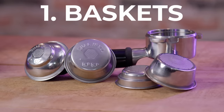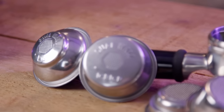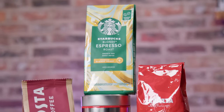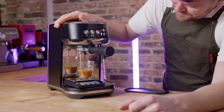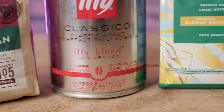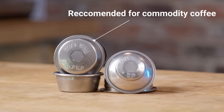So why is this really small, relatively cheap machine capable of making such good espresso? There are five main reasons. First, let's have some basket banter. The Bambino Plus comes with both standard baskets and pressurized dual-walled baskets. Most cheaper entry-level machines are pressurized basket machines made to work with pre-ground coffee — they're more about making espresso look and taste the part, which is why Gaggia refer to them as perfect crema baskets. You can't really dial in with pressurized baskets. If you're using commodity coffee with no roasted-on date, you're better off using a pressurized basket.